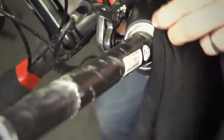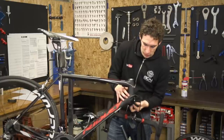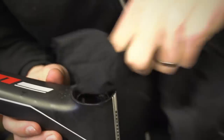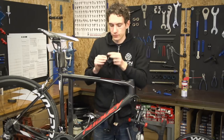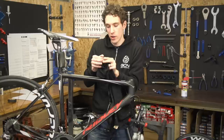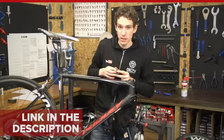This one's actually not too bad — it's pretty well sealed. We need to thoroughly clean the inside of here and pull the bearing out of the frame, then get fully stuck in with a rag and really clean all the gunk out of the inside — this is possibly the most important bit. We'll do the same at the top. It should be absolutely spotless in there. Now if you do need to replace your cartridge bearings, there'll generally be a serial code printed on them that tells you what you need to replace. If it's not on there or it's corroded off, Cane Creek actually has a really good facility on their website where you type in the make and model of your bike and it tells you what headset bearings you need.